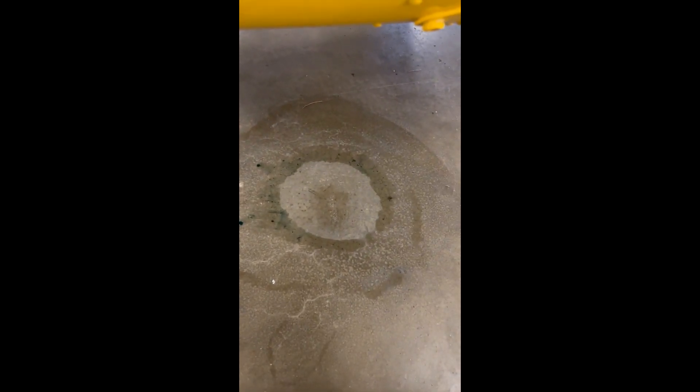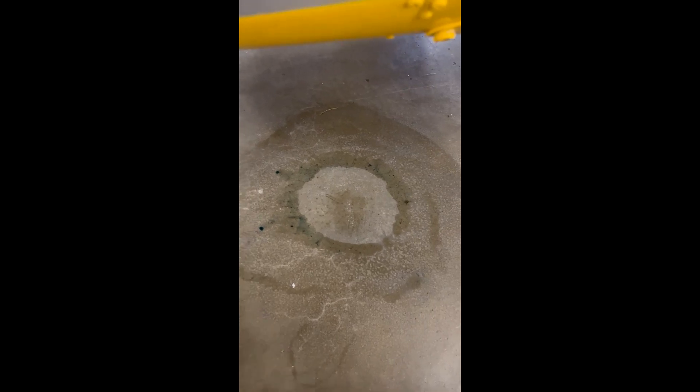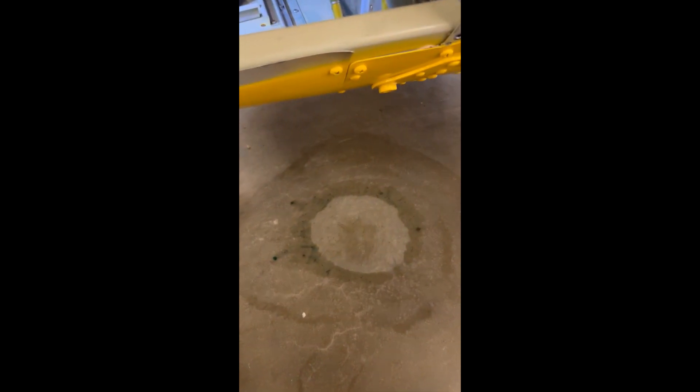This aircraft is having a 100-hour inspection done. I noticed a large stain where fuel has been dripping onto the floor from the aircraft. The panel is off, so it's quite easy to figure out the problem. If you look right up here, you can see it's stained down there. The gascolator has got a leak — it's likely the gasket on the bowl of the gascolator. That's going to have to be fixed, and that can be one cause of fuel staining underneath the aircraft.